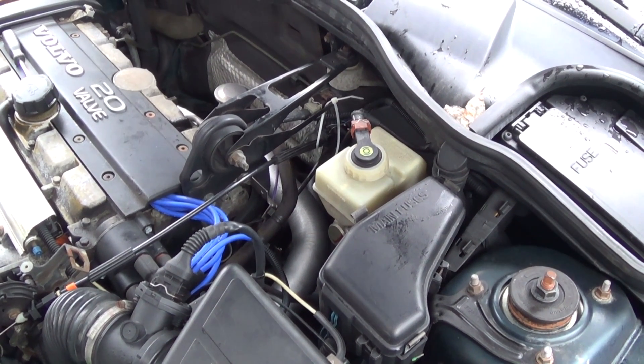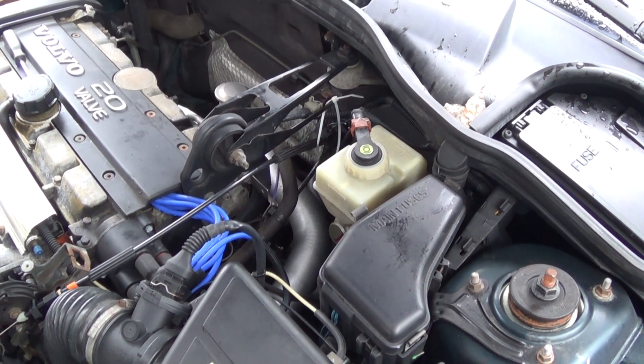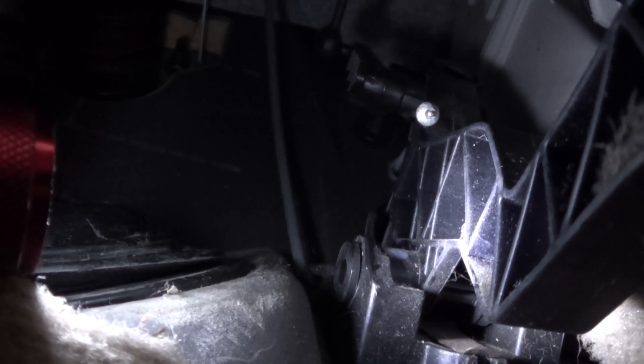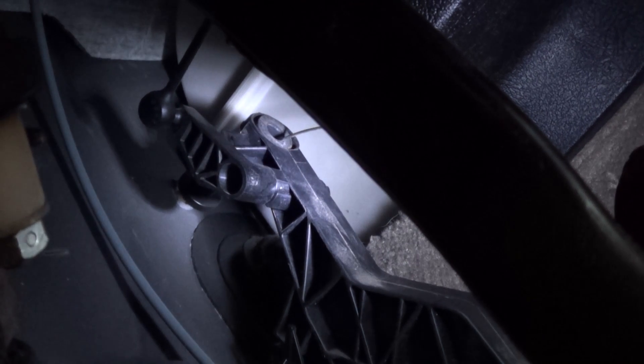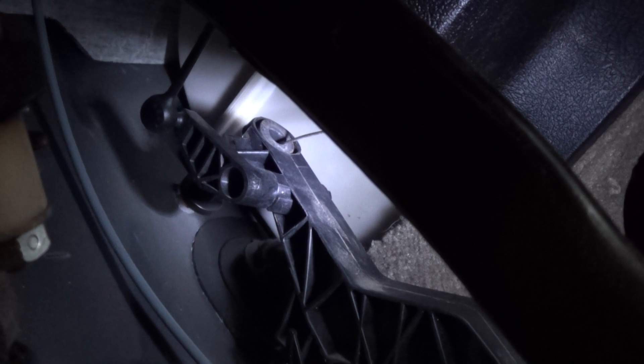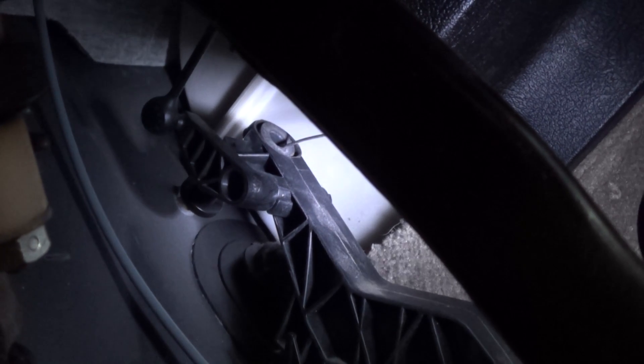Once I have it disconnected, I'll do my best to describe how to disconnect the cable from this end. Now that the cable's through the firewall, we're going to go into the car and reconnect it to the pedal. Once again, this is not something I'll be able to show you — there's just no room in here — but you can see the cable hanging down right here. I've got to feed this through the appropriate hole on the accelerator pedal up top there, and then reinstall the clip. Looks like I just barely found the right angle to show you. If you look right where my light is shining, you'll see a hole right there through the top of the accelerator pedal with a rubber grommet, and you'll see the cable hanging through it. Now I just have to pull the cable down and reinstall that white clip. I wasn't able to show you, but now you can see the cable's back in place with the clip.